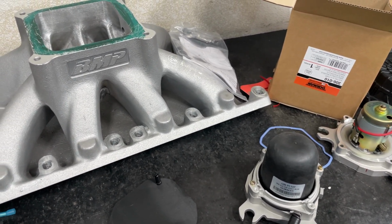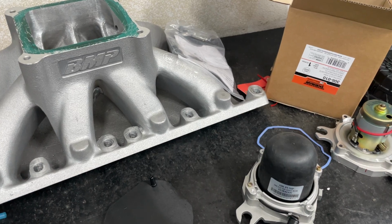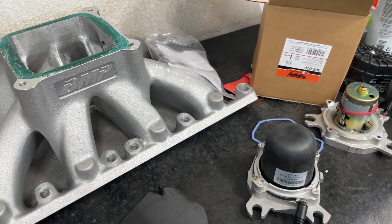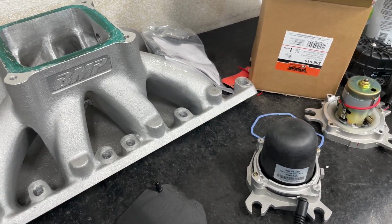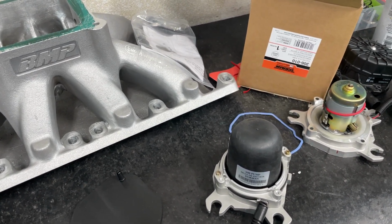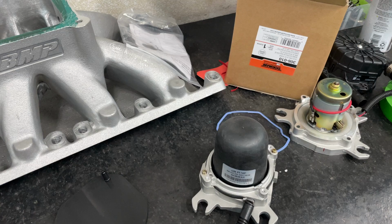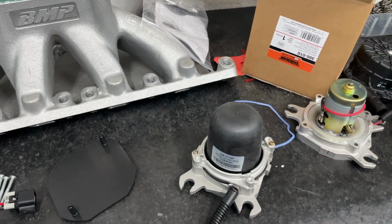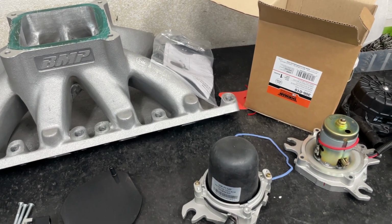Anyway, he was on there talking about, because I guess he used to work for Trick Flow, and he was a cylinder head porter, which I didn't know. But anyway, he talked about coefficient of discharge. I don't agree with it entirely, which I'll get to. And this is what I mean by, I've been wrong about stuff, and I may be wrong about that, but I don't think so, because I've had a lot of experience where I've had two heads where one flowed more than the other because it had a bigger valve. The coefficient of discharge was less than the other, but it made more power everywhere, which we'll get to hopefully in a different talk, because it's way too long to discuss here. I'm not saying he's wrong, because he's right in several instances, but I've just seen some times where it's not that case.